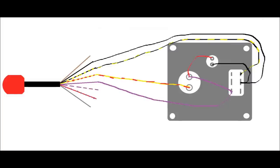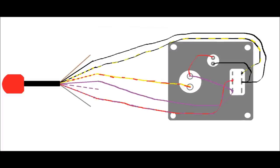We also want to make that light come on when the switch is on. For that, we're gonna run another purple wire. You could tap into the switch with the toggle, but there's no real need since it's gonna get pretty packed in there. So we're gonna jump it from the switch to the light — the light has a red wire coming off it, so my little picture will basically show a red wire. This will make the light come on when the switch is on. Now we need to power this whole circuit, and that is where our red with purple stripe is gonna come in handy. The red with purple stripe is going to run across the switch and go over to the middle toggle, and that will power everything when the switch is turned on.